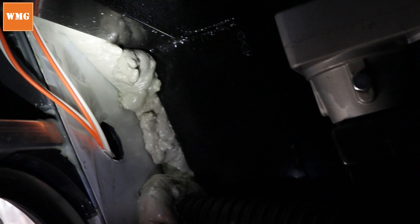Before we leave this forward storage area, I wanted to show you that you want to make sure you look for entry points from this storage compartment into the main cavity below the RV and seal those off as well. The last thing for the storage compartment is sealing the walls where they meet the frame, going all the way up to the ceiling. That sort of makes this compartment its own sealed-off cavity.